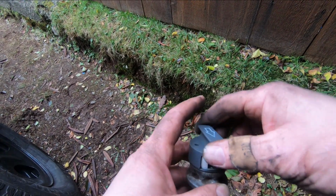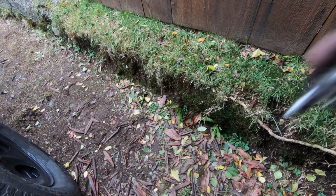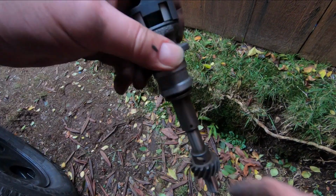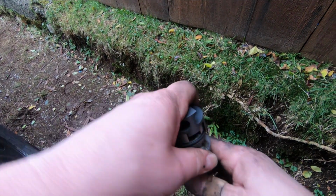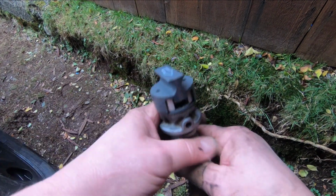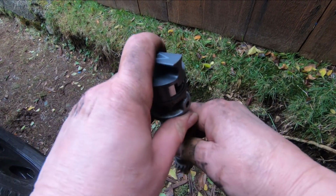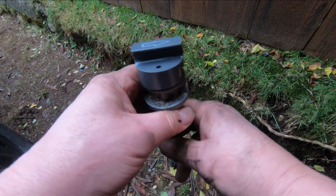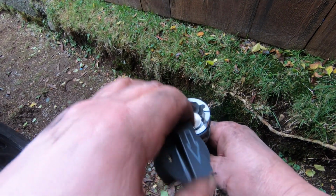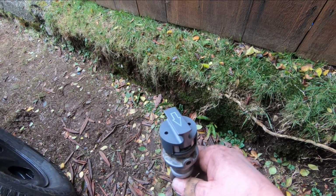So you line it up, put the tool on, and when you know it's in the right position, pull out the synchronizer, put the tool on the new synchronizer you're going to install, make sure it's in that position, drop it in, and tighten it down. How far it's turned one way or the other is not critical. As long as you've got the engine timed like that and followed those steps, you don't have to worry about which way this was pointing exactly when it came out, because it's a circle, it could be anywhere. If you've got the static timing set, with that little half moon off to one side with the tool on before you take the synchronizer out, you know your timing's on.